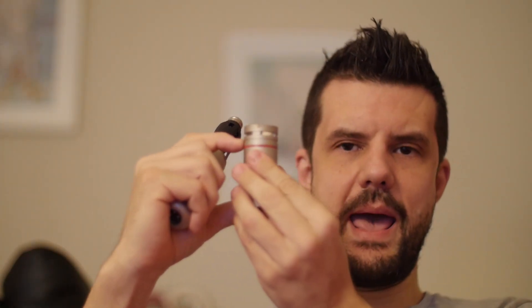Since this unit already had its grill removed, I'm just going to cut the excess material. Now, if you're using this microphone for voice recording or voiceover, you actually need the grill in front of it because it has a foam sponge inside which blocks pops and plosives. But an even better way is to use it without the cap and use a regular studio pop filter instead. I suggest that if you don't absolutely need it for aesthetic reasons, you should just remove it.